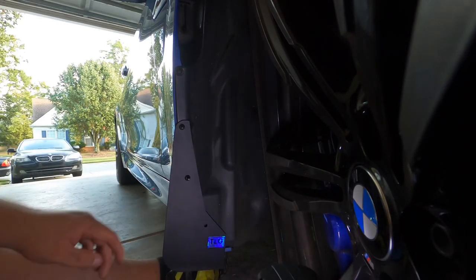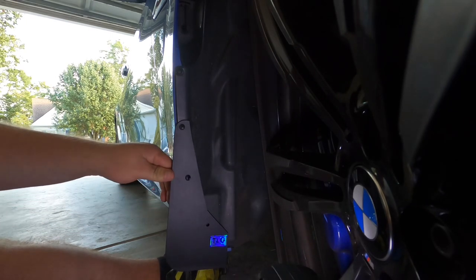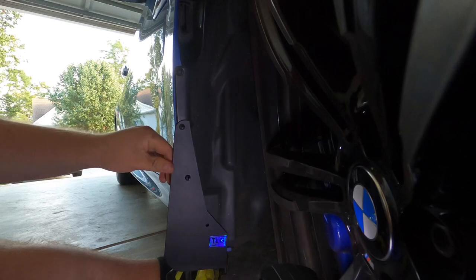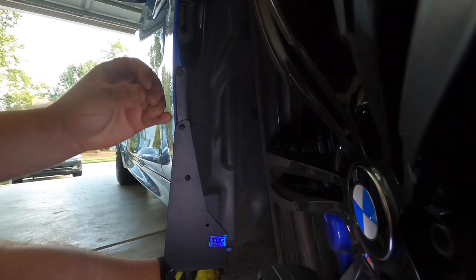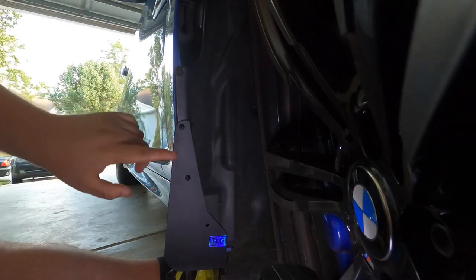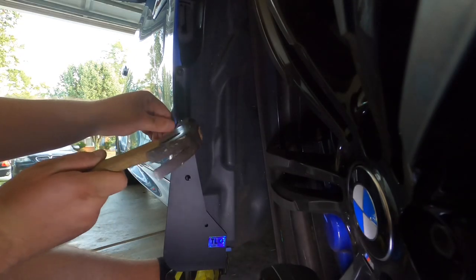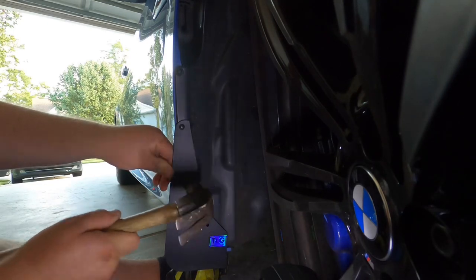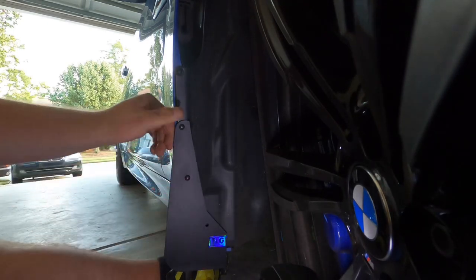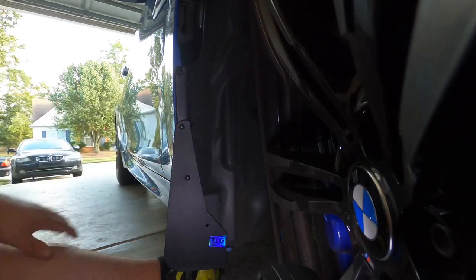There's not a hole for this one so you do have to push it in. Take your hammer next and do this very carefully — we're going to hammer in these pins, which is what expands the plastic on the inside and holds these rivets in place. Just tap these lightly until they're flush, the same way they were before we took the old ones out.